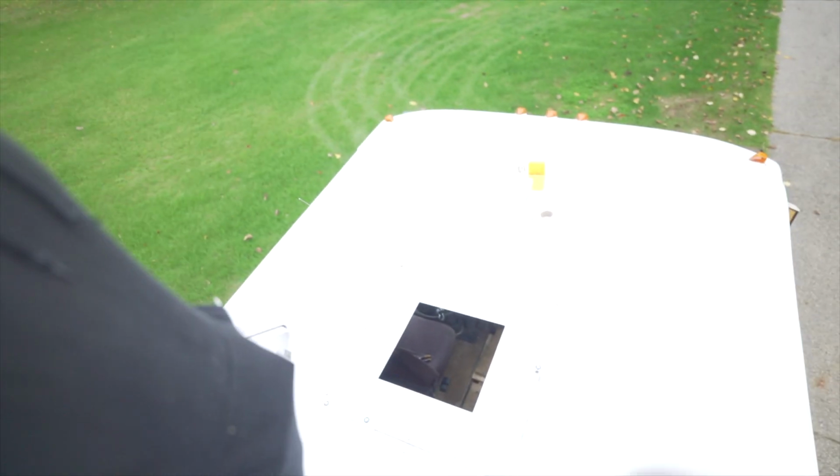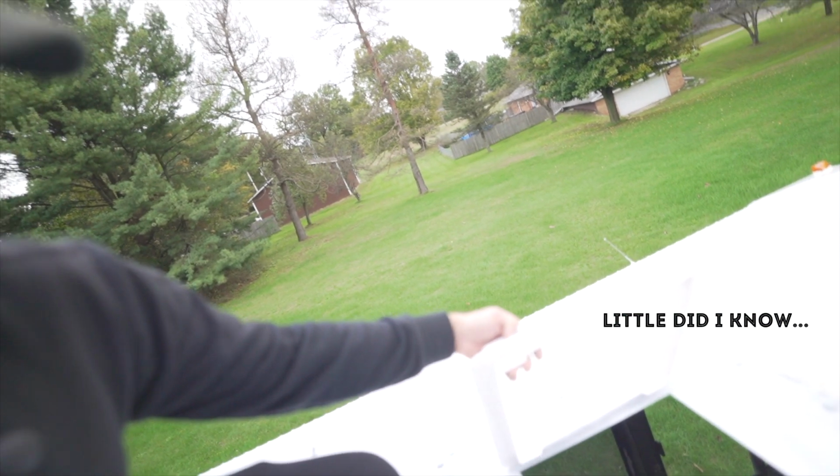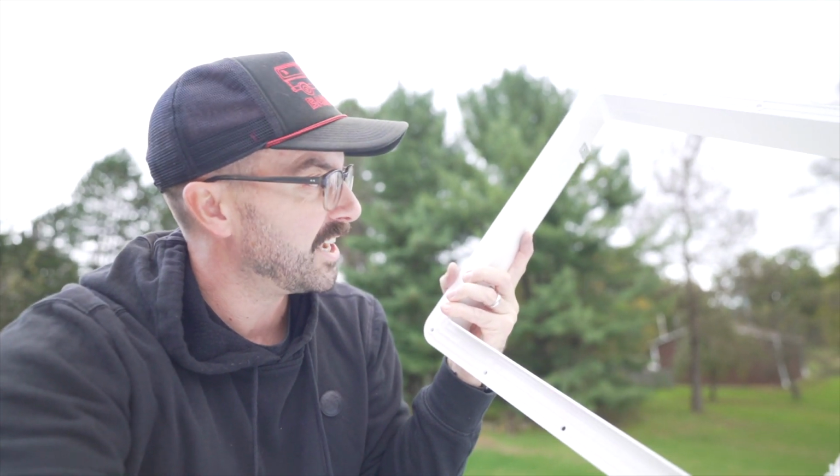So gonna get this ring installed in here. Oh, I'm done. And then we'll put that piece up on top. This is gonna go pretty fast. I mean, that's the nice thing about having your cutout already done. I'll put some more butyl tape on the bottom of these edges, drill some holes, screw it down, and then we'll get some lap sealant on all of it and we should be good to go. I just felt a little sprinkle, so maybe we've got some rain coming, so I'm gonna get cranking on this as soon as I can.